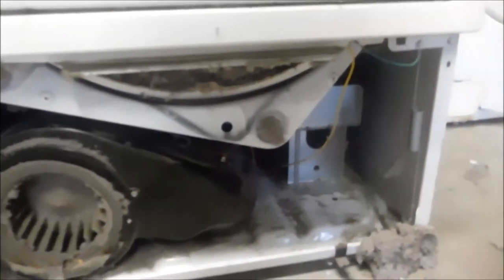Okay, so we have the front panel loose. There was still quite a bit of lint inside here. You can see the lint built up on the motor — this will cause early failure of the motor and we'll have to clean that off. We can access the heat element. We probably could have accessed the heating element from the bottom, but we might as well do this because it's going to prolong the life of the motor. Basically we're going to lube all the moving parts to make them last a little bit longer.